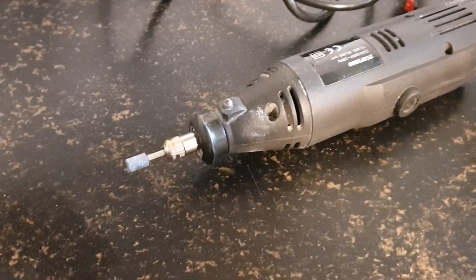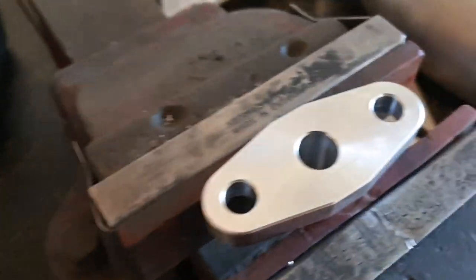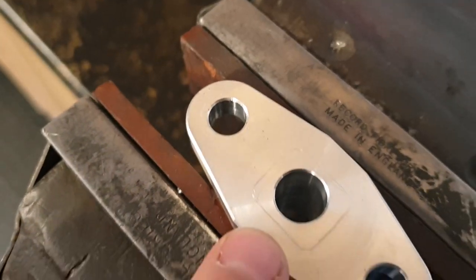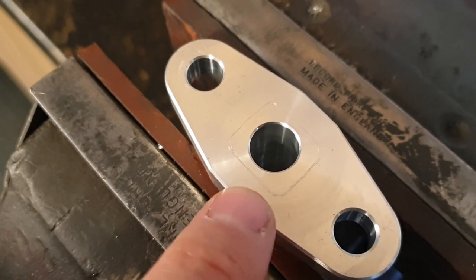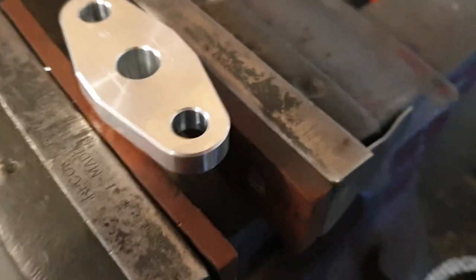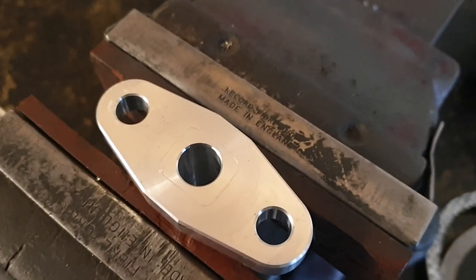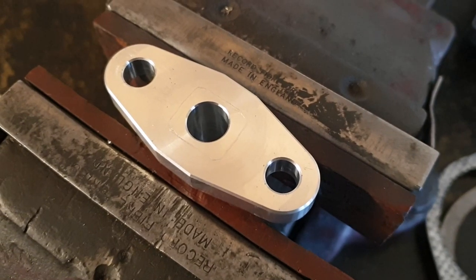One of the jobs I'm going to do is use a little die grinder on a Dremel. I've just marked my oil drain for the Borg Warner. It's actually a square shape from the gasket and the hole in the bottom of the turbo is actually a square shape, so I'm just going to round that off a little bit and open it up. If you look at the posh companies in America who make the AN10 oil drains, they do that and it looks quite smart. So I'm going to do it too - I'll update you with the results.